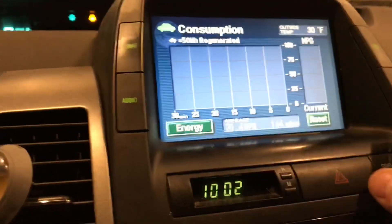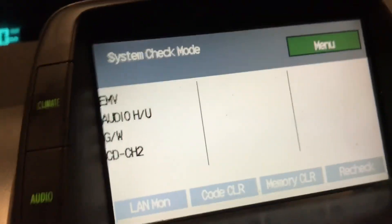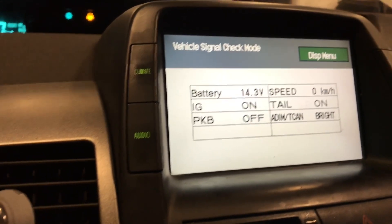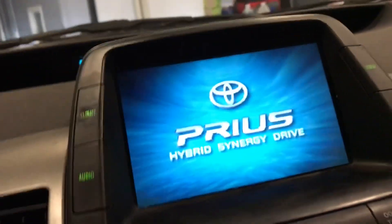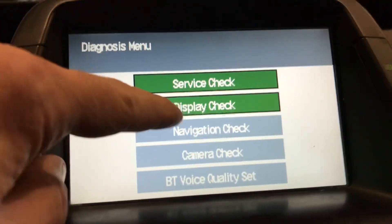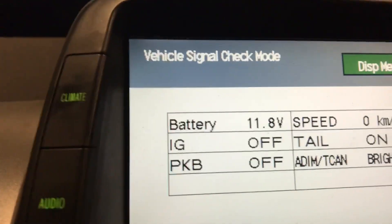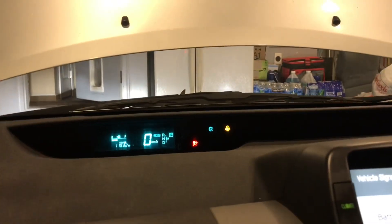I went back to info and nothing changed. That's when I hold the info button and turn the headlights on and off three times: one, two, three — bring up this screen. When I check the voltage, I'm still getting the same reading. Now I'm going to shut off the car. I'm going to go back to info again, hold info and press the headlight switch three times. As you can see, it's at 11.8 — basically where it was when I started. So the voltage hasn't changed, but that wire has. Now when I start the car and turn off the wipers, the red triangle of death is gone.